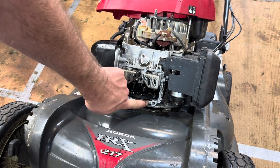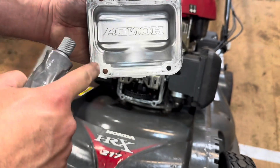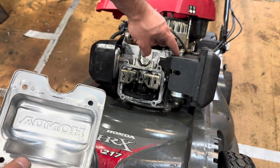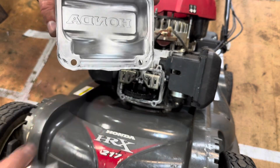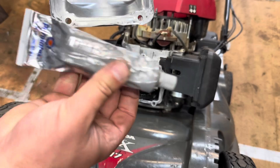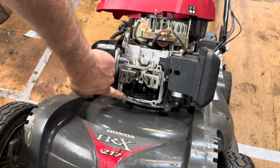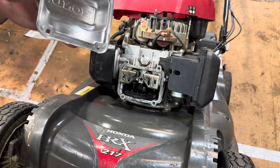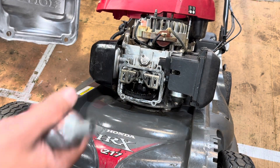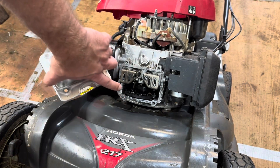Got it cleaned up decently — not perfect, but there's just a little staining, you can't even feel anything. I also cleaned up the inner lip of the valve cover. At home if you're doing this yourself, you might be able to just re-put it back on and it could seal on its own, but I don't want this thing coming back. I'm going to put a thin layer of gasket maker on this with my finger and tighten it down. Don't over-tighten — you can strip out these bolts. Probably around 10 foot-pounds — use common sense.